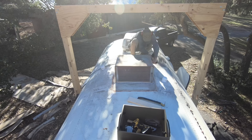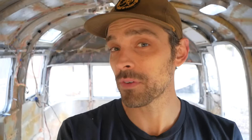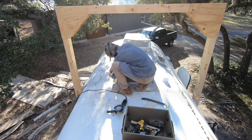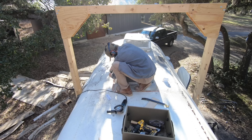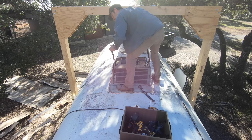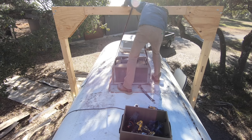The AC unit — that was a huge chore, because it was really full of Vulkem, especially on the inside. The great thing about the AC is it had screws instead of rivets, which is a little bit faster to remove, although the screws were rusted and corroded onto the aluminum, so some of them had heads that stripped out really easily. But once I got the screws out, I still couldn't pick it up — it was stuck. Trying to leverage with a crowbar was a bad idea; I was afraid I was going to dent something. So it was really hard to find any way to lift it. I did a lot of cutting on the inside of the Vulkem, and finally just grabbed a ratchet strap, hooked it to the gantry crane, and cranked on it — that popped the Vulkem loose. Then it was just a matter of getting underneath it and lifting it myself. It wasn't as heavy as I was expecting, so it was actually pretty easy to manage once I got it free of the trailer.